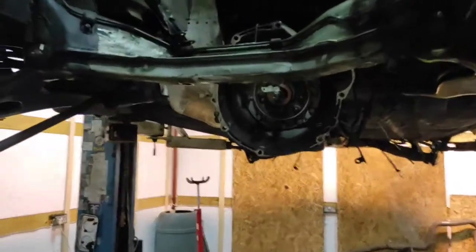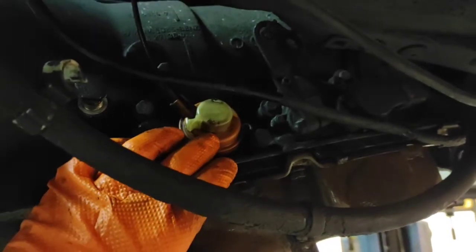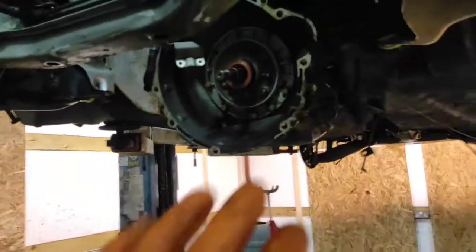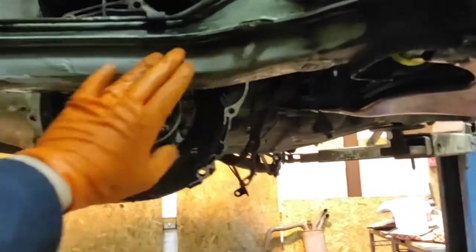Today's mission is to clean this engine bay of all the grease. I had the gearbox pan off and I was trying to clean it - I actually just put the old gasket back on, because I'm going to be using petrol for cleaning. I'll clean off all the grime and grit and then do the proper gasket. I already put in my diesel shift actuator, which came from the 722.4 gearbox that was in the OM606 NA W124 model. It gets a feed off the manifold, and the springs are rated to the diesel's vacuum rather than a petrol engine's higher vacuum, so it should help it shift more accurately for a diesel.